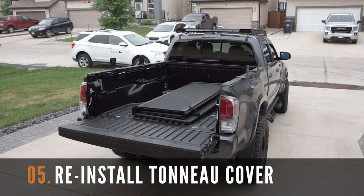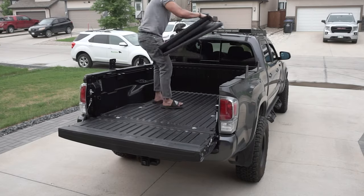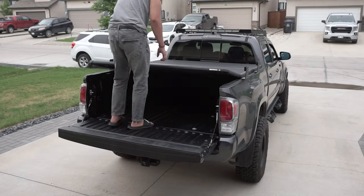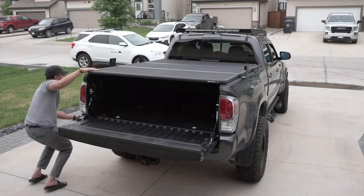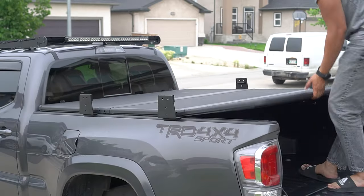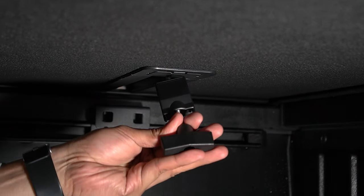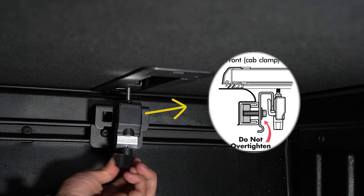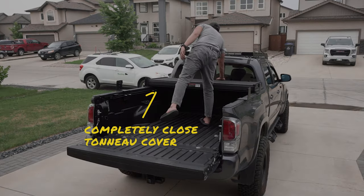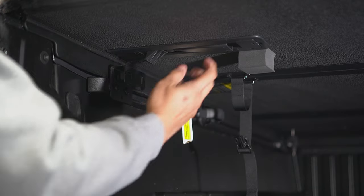After installing the brackets, we'll need to reinstall the tonneau cover to make sure it fits with the bed rack system. Grab the fully folded tonneau cover and place it back over the front of the truck box. Make sure the long side is on the bottom, then remove the security latch and unfold the cover fully. Adjust the position so it's equally spaced on both sides and the rubber seal in front is touching the truck bed. When complete, carefully fold the cover without shifting its position. Then pull down the front clamp and slide it in at an angle until it's touching the front clamping brackets, and tighten it by twisting the T-handle until the cover is secured. Repeat on the other side. After this, unfold the cover completely and clamp the rear in place by pulling the spring-loaded rear latch until it's secured on the rear clamping brackets.